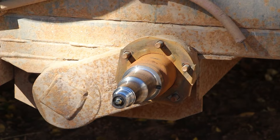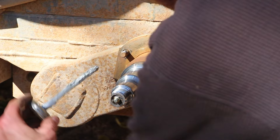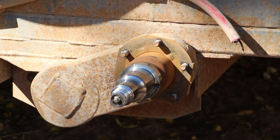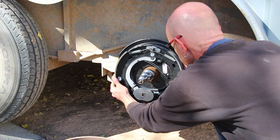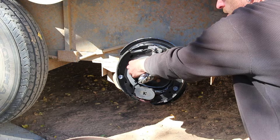Another quick wipe down of the spindle to make sure there are no rust particles. Now this step is optional, but I'm gonna put just a tiny bit of anti-seize on these bolts — they came off a little harder than I expected, so I want to protect them from seizing up later on. And now for the best part — there are our new brakes. I'll just reinstall the washers and nuts that we removed earlier, leaving them a little bit loose in case we need to wiggle things around. See, I told you it was easy.